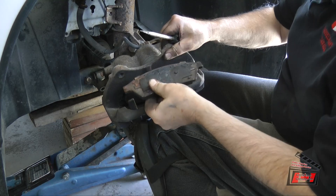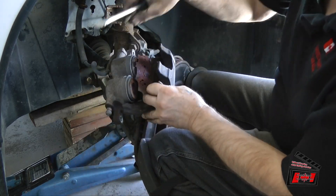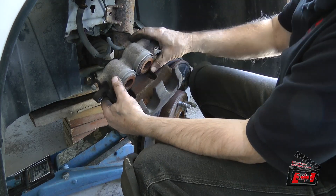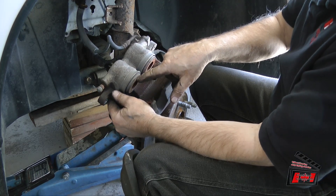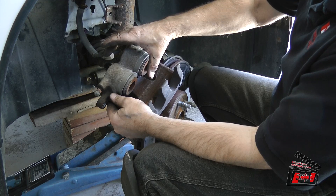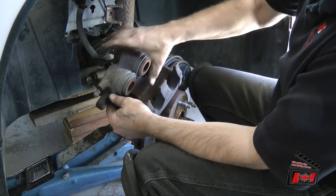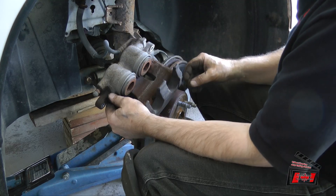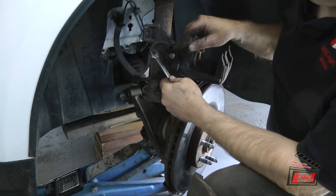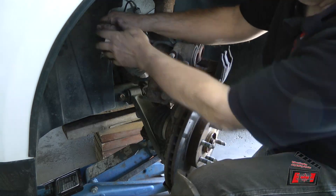Got a hammer — there's the brake pad. Now look at that, it comes out. The other brake pad's in there too. Rust, rust, rust. Those pistons are definitely not pushed back far enough. If you've got it out this far, don't hit it with a hammer. You might take huge vise grips or a C-clamp, put a piece of wood or an old brake shoe in there and squeeze from the outside to push those pistons back. But for me, that old caliper is going to the trash. Let's crack this brake line out.